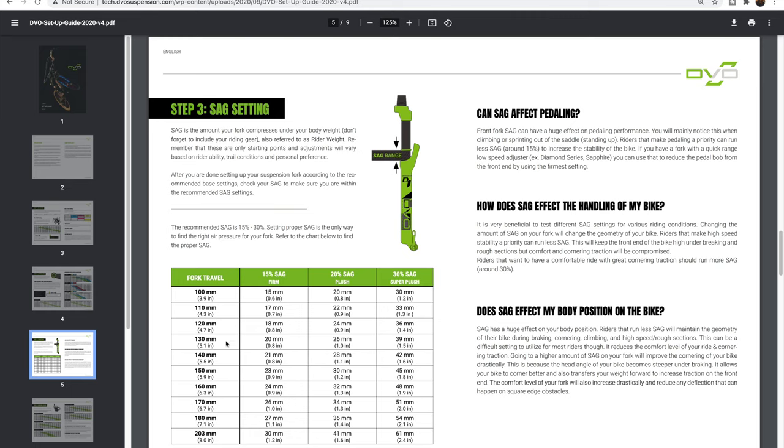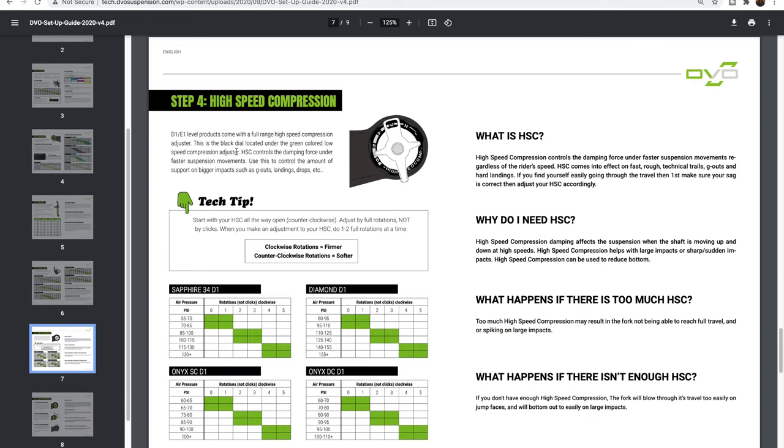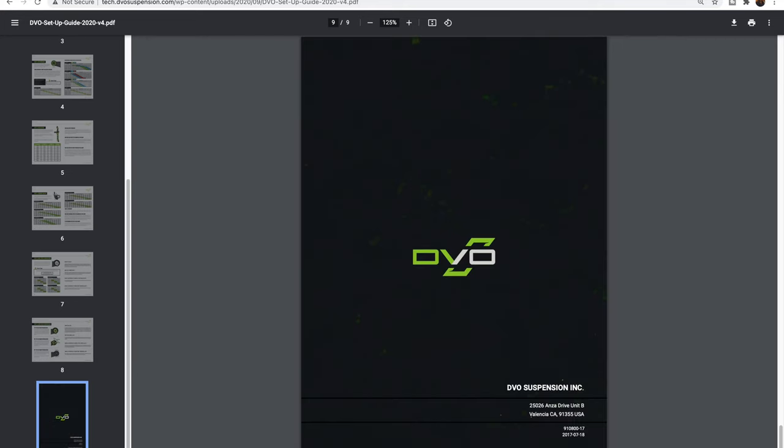From there, the sag setting is right in the middle — shooting for around 20%, sometimes I lean a little closer to 30% — and you adjust that just by tweaking the air pressure in the fork a little bit. Then you move to rebound. Rebound is not terribly picky and easy to adjust on the fly. Off that 80 psi I'm right in that 10 to 12 range, shooting kind of right in the middle at 11 clicks. From there, adjust high-speed compression first — I go right in that three to four revolution range — and once that's dialed in, the low-speed compression is the green click dial. I run it either fully open or one click from open.